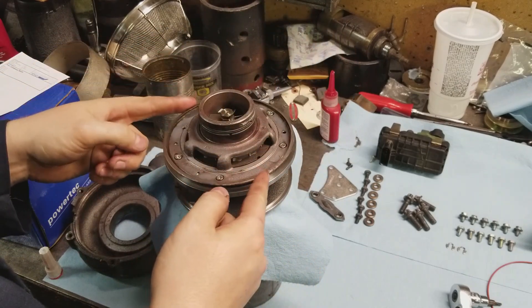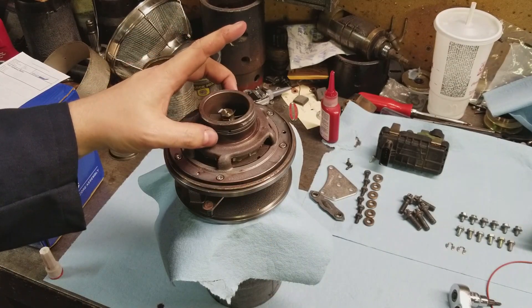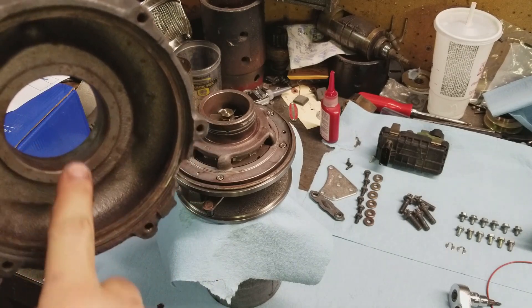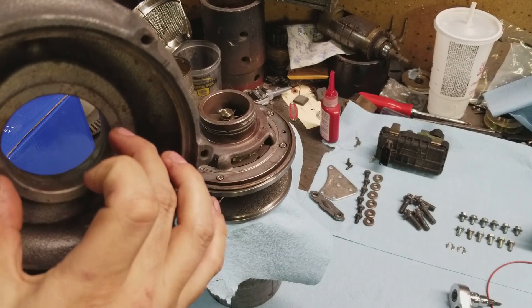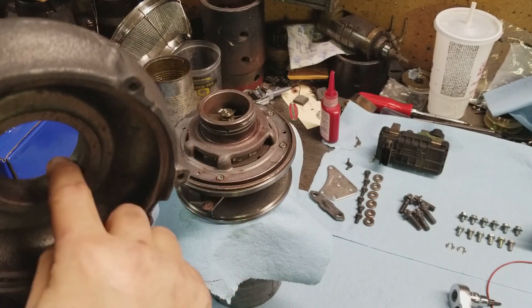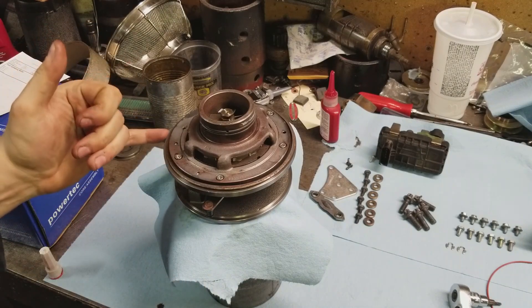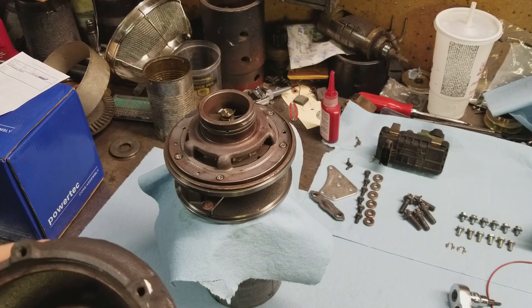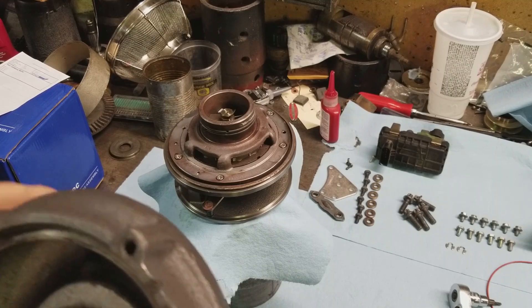You're going to place this right here. There are sealing rings on the top — they're kind of like piston rings. When tapping this housing over, there's a little indent on the bottom which is going to allow those rings to compress and then slide in. This is going to get clocked because there's a slight pin on the side that's going to line up with a pinhole on the side of this housing — so you can only put it on one way.